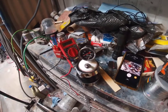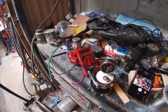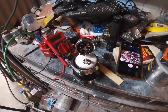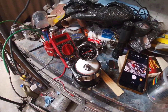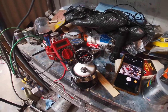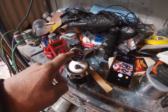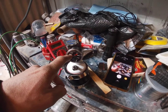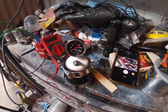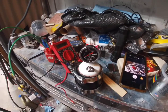I was going to try smoke, but after watching a lot of reviews, smoke works really great for naturally aspirated vehicles. The problem with a boosted car is you want to simulate your car under boost so you know where the leak is. That's what this gauge is for — when you feed compressed air in, the gauge goes up to your desired boost level. I went to eight pounds because that's all my car is set up for, and I found the blow-off valve was leaking really bad.